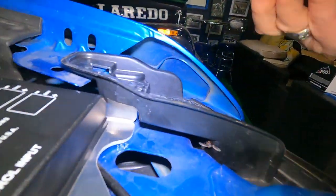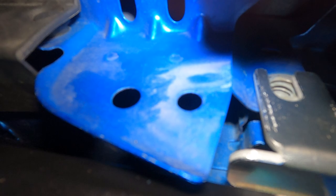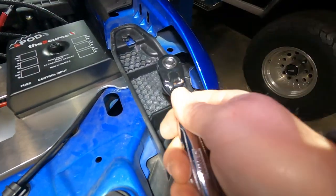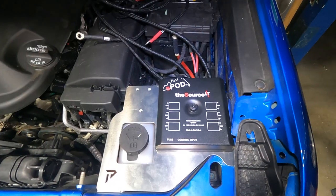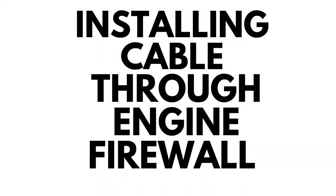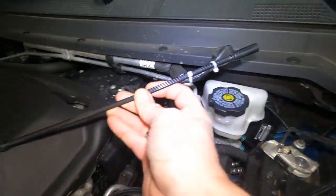Towards the front of the truck you're going to put the bolt back in underneath that plastic fairing — the power tray goes in there. I just couldn't film it because it was such a tight area. Reattach those two bolts after the power tray has been installed and put that 7-millimeter bolt back where you found it. This is what it should look like when installed — it has two attachment points.